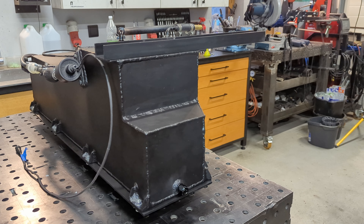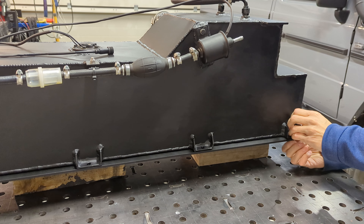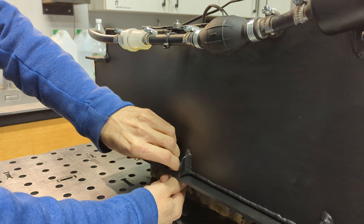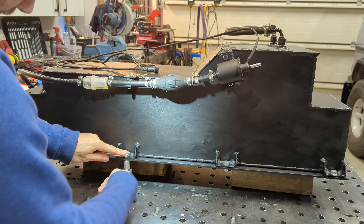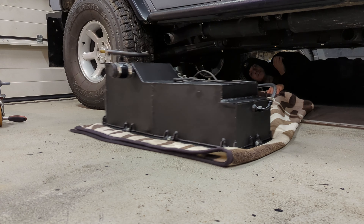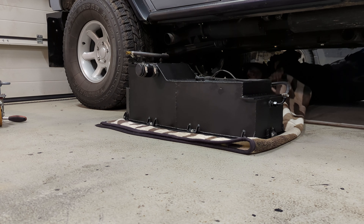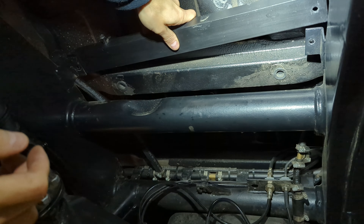When you think about a fuel tank you may see it as a single part. But in reality, when you start to design one, you realize there are so many things all around it. There must be a fuel inlet at the top, fuel drain at the bottom, fuel outlet, filter, primer and electric pump, and air vents.